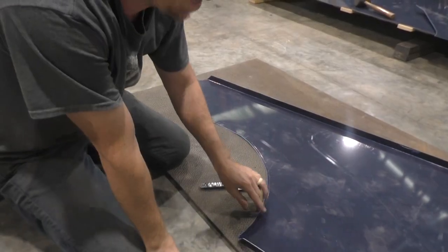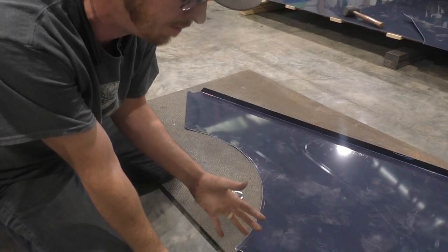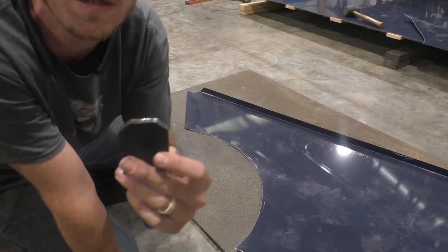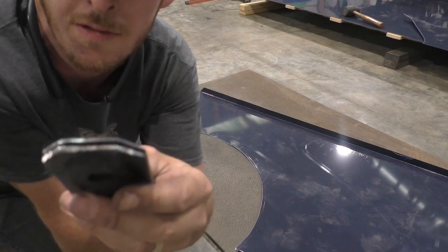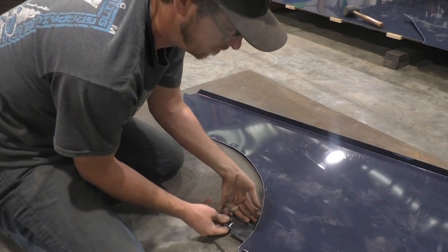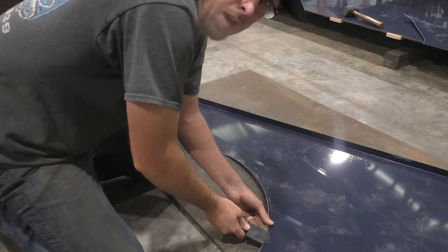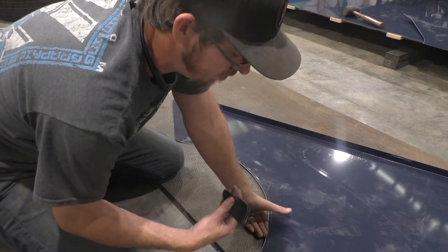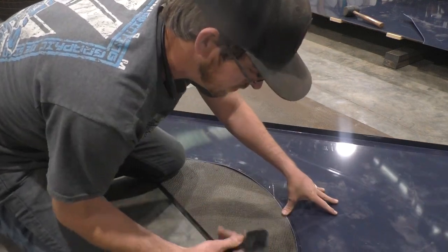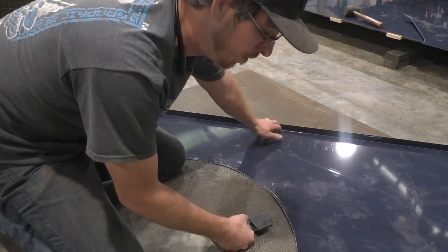You don't want to leave a sharp edge right here to cut your tire down. Why take this much time to do this and not just go and hem that? What I've got here is just a piece of quarter-inch by two flat stock. I've taken a port-a-band and cut me a little slot in there and sanded it down, so it'll just slip right over the sheet metal however deep you want, and you can just bend up. You can do this with a piece of wood, or just use a crescent wrench and do every quarter inch — I did that for a long time. Seen somebody else do this and I decided to copy it. We're going to stick this in, bend it all the way up, bead everything down flat, and then make our brake up top.